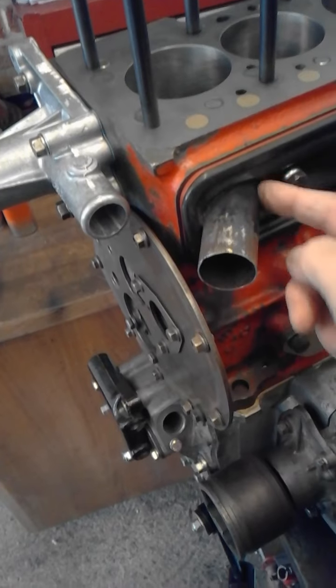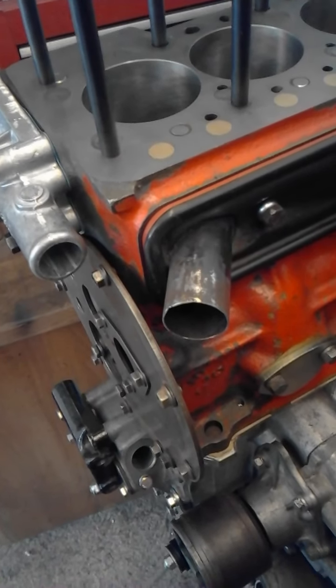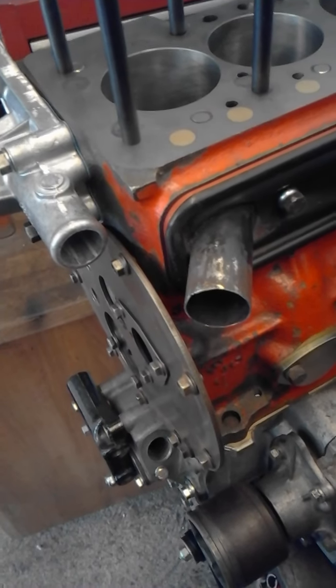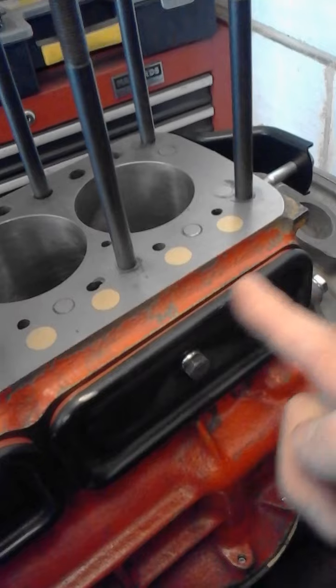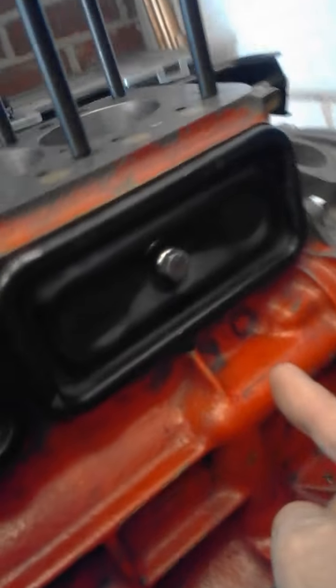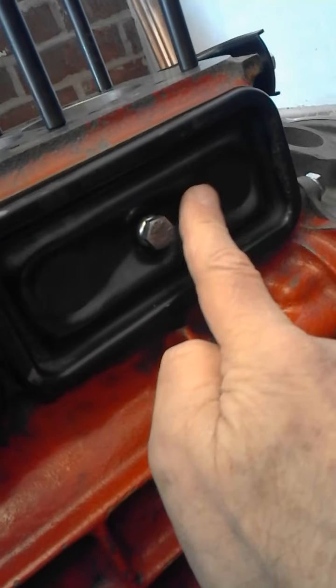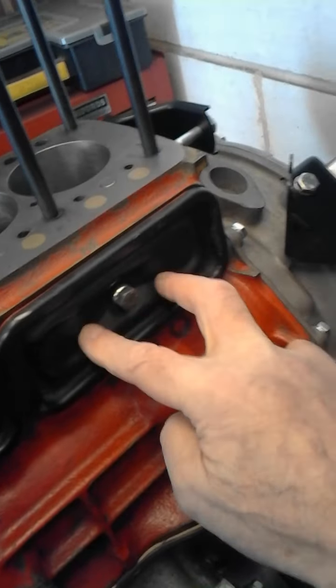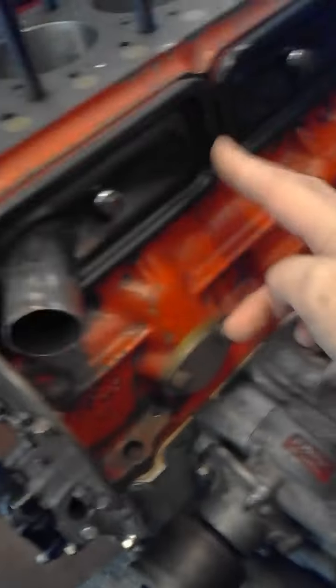On the head itself there are two dry oil drains that come down about here, and conveniently on the tappet plate there are two little flat pressings, so they'll just return from the head straight into their drain. That will be the oil return. On 1275s that don't have these...